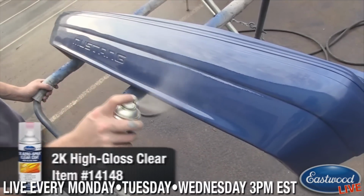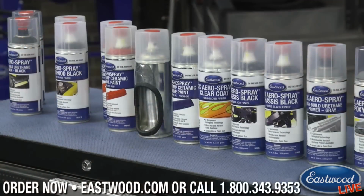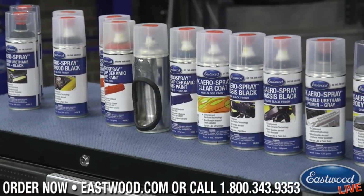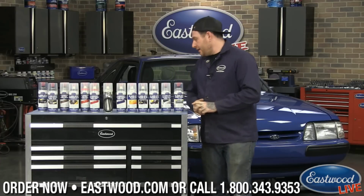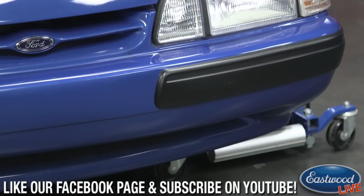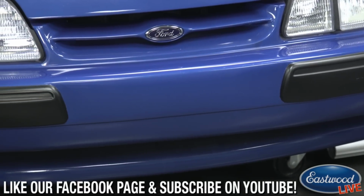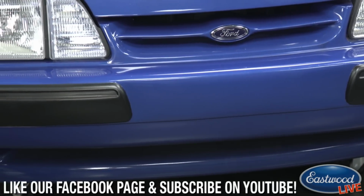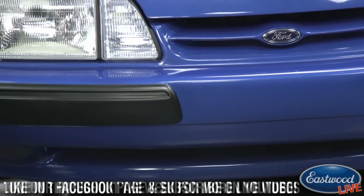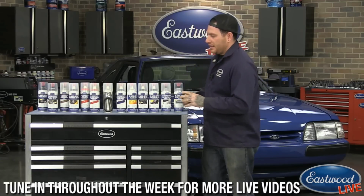We used the 2K aero-spray gloss, the high gloss, over top of our paint to get a really nice gloss finish on the bumper. And it looks the same as the car, and you can't really tell the difference between what was sprayed with the actual gun and what was sprayed with the 2K aero-spray. It's got that great of a gloss level to it. And again, it's just as durable because it is the same exact type of materials that you would spray out of your gun.